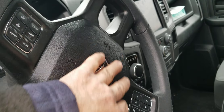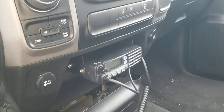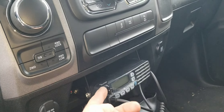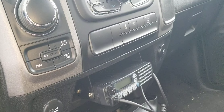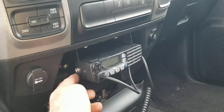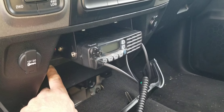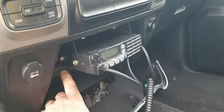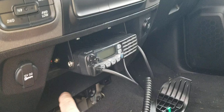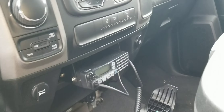To install the radio here I just use the bracket — the radio bracket. I drilled the four holes using the plastic type of screws; they are metal but made for wood and plastic, and they come with the radio kit. I did not have to drill any holes because under the tray there is a little rubber mat with two holes, and I use those holes to insert the cables through. The power connector and antenna connector come at the back of the radio, so it's a bit of a tight spot — that's why the radio is not tilted towards the driver, but aesthetically it's not too bad.